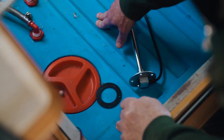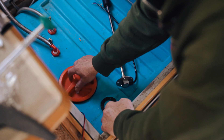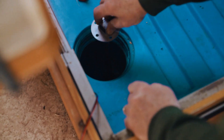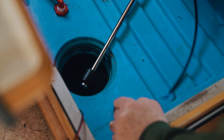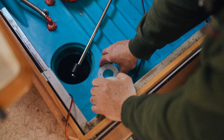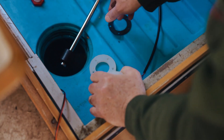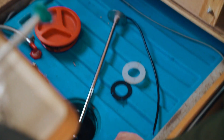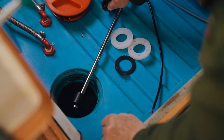Here's my fresh water tank. I measured it to be 400 millimeters deep, so if we take the lid off and check it out, it's got quite a lot of water in it at the moment. It's a little bit shallower than 400 millimeters, so what I've done is I have these two acrylic discs that I've made. The idea is that I'll be able to mount this on here with Sikaflex, which will raise it up a bit. I need to decide where to drill the actual hole — I've got my hole saw ready, just need to mount it in the drill.